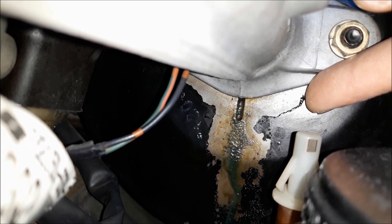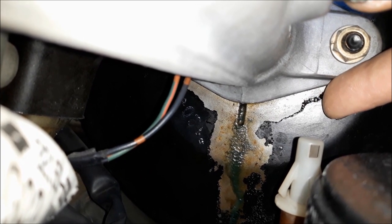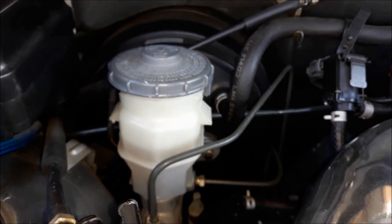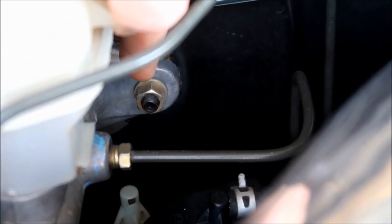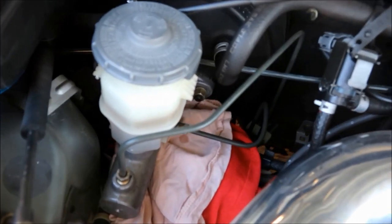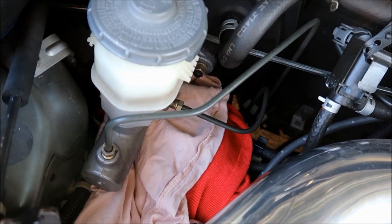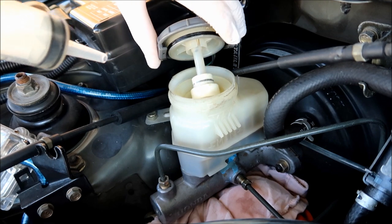That's a perfect way to guarantee your master cylinder needs to be replaced. Now, just so you guys know, this is a secondhand one I had put in, but I only got five years out of it unfortunately. The new one I'll be putting on has been reconditioned by Bursons. This one right here is a 12 millimeter, and the lines are 10 millimeter. Also, be advised — put some rags underneath because we will be making a bit of a mess. I'm going to take the excess fluid out with a syringe to minimize the mess.